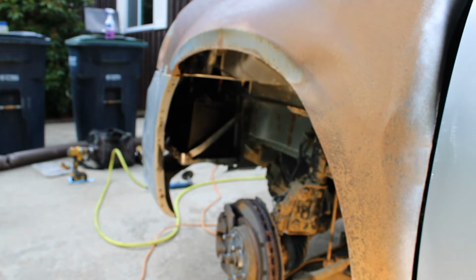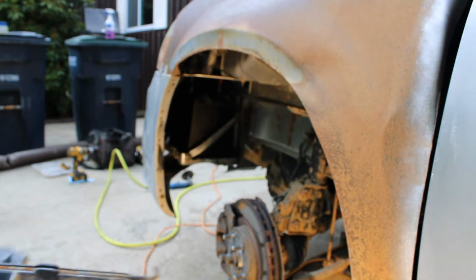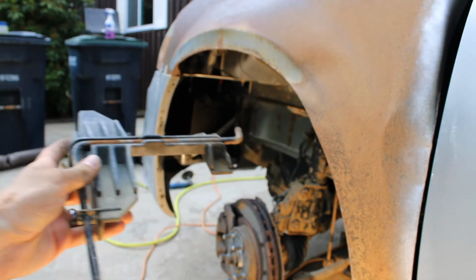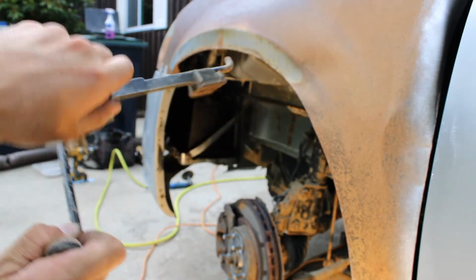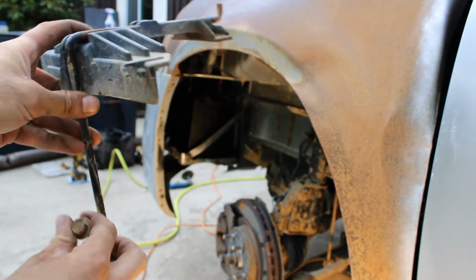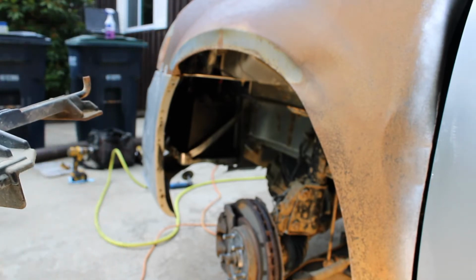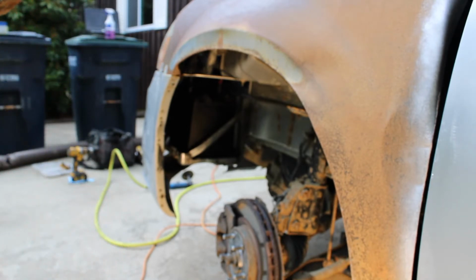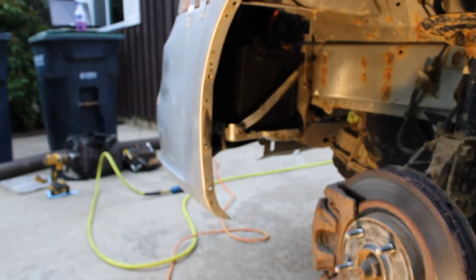So our next step is going to be to put the battery bracket back on. That'll be this guy here. We put it in here like this, and we're going to turn this thing 90 degrees and put our bolt down in our hole. I always put anti-seize on my bolts when I throw everything back together, just in case I got to tear it apart again, it comes apart a little bit easier. Next up, we can throw our inner plastic back in.